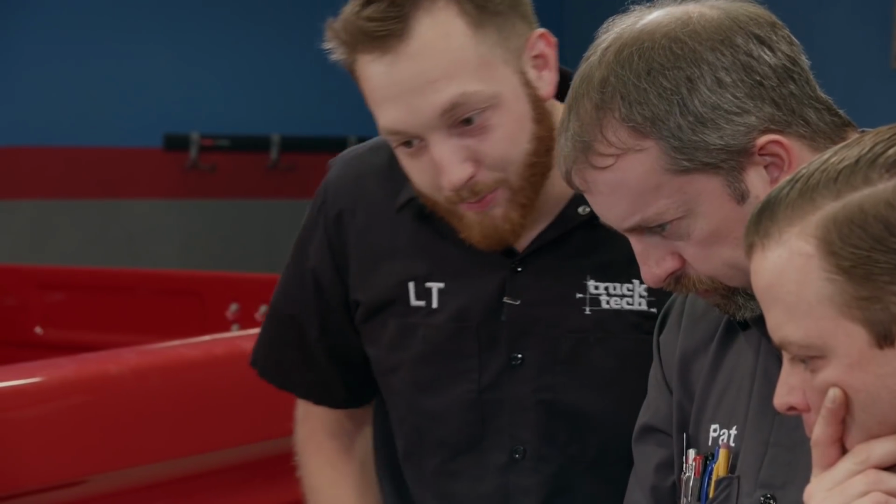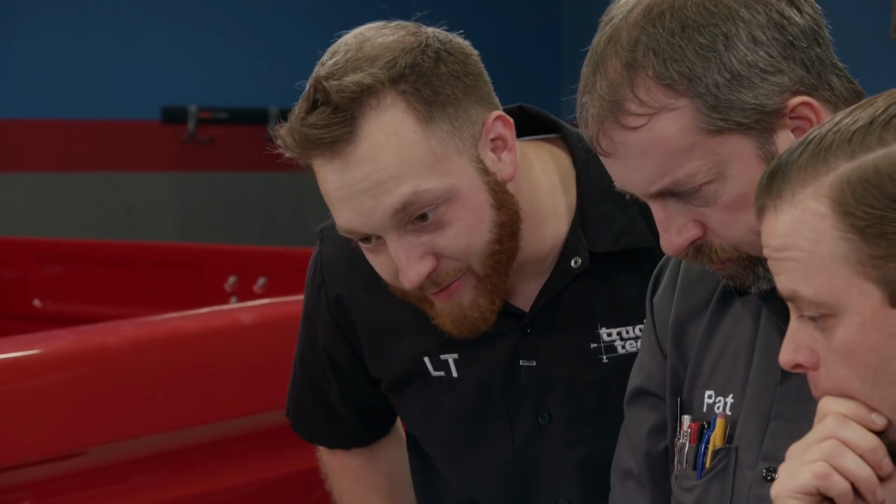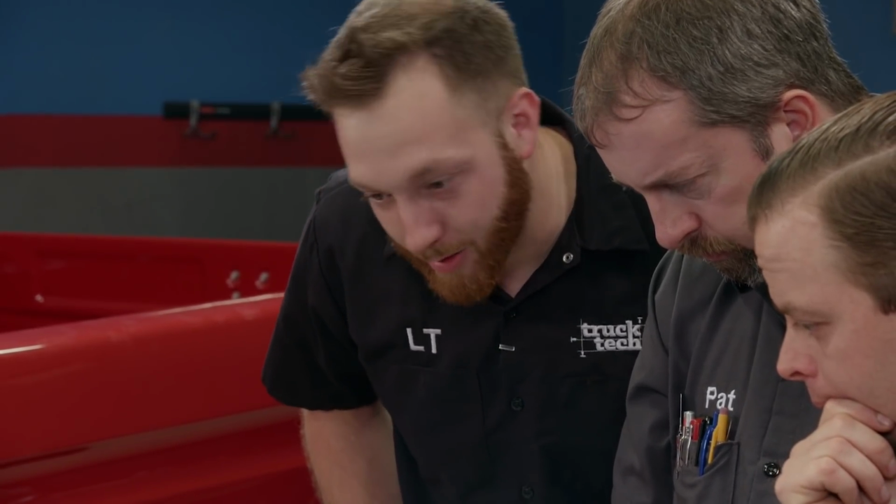Wow. I haven't seen anything yet, but I'm changing my guess to 75. This thing has a tall gear in it. So 146.48 horsepower at 3,700, and 225 pounds of torque this time at 2,800 RPM.